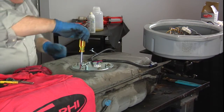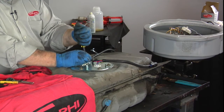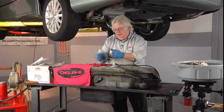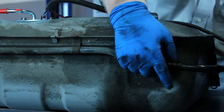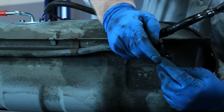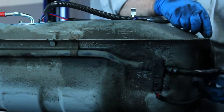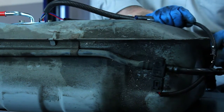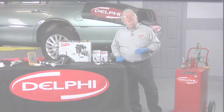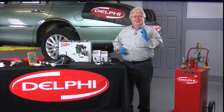It's a good idea to put the red protective cap back on to keep dirt out of the pump and tank as we raise it back up on the transmission jack, put it in place, hook up all the lines and hoses, tighten the straps, and add fuel to get the customer back on the road. We'll make our last connection — the one you don't want to do while it's on the vehicle with no room to reach — sliding the connector onto the fuel vapor pressure sensor and popping the wiring harness clip into place. There we go — a complete hanger-style fuel pump assembly, ready to go back in the vehicle. Thanks for watching, and be sure to check out more of Delphi's how-to video series for more tips on saving money and time in your shop.